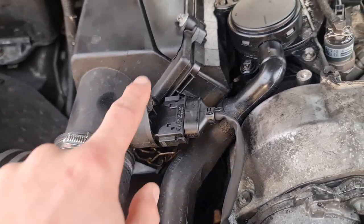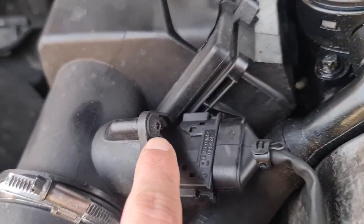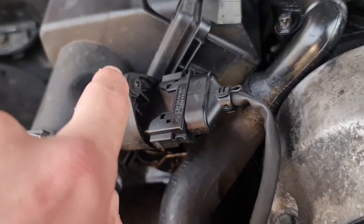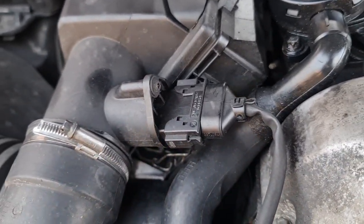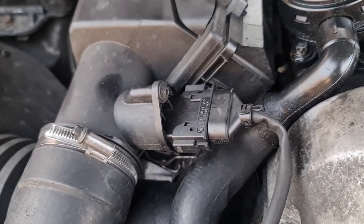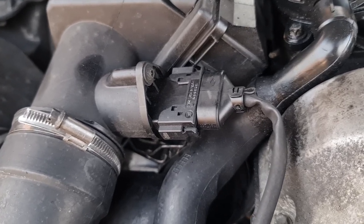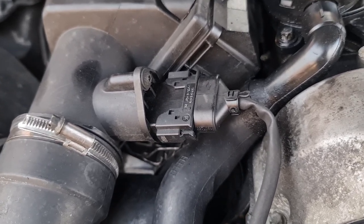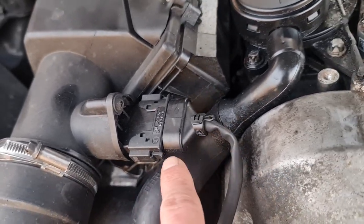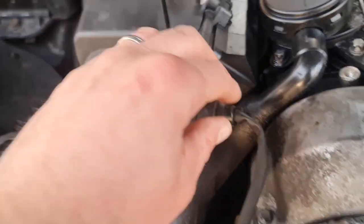When I got back, I removed the sensor, which is very easy — it's only two Torx screws, one in here and one at the top. I removed it and I cleaned it, put it back together, went for a drive — no difference. The third thing I did was I checked the voltage at pin 5 on the connector with the engine running.